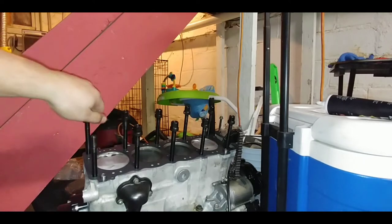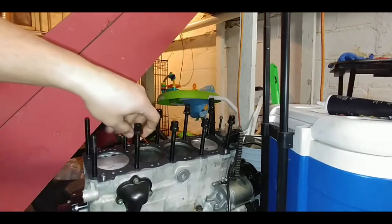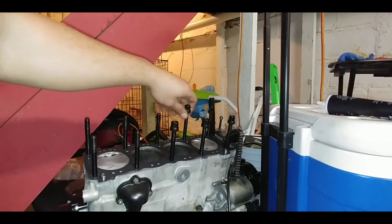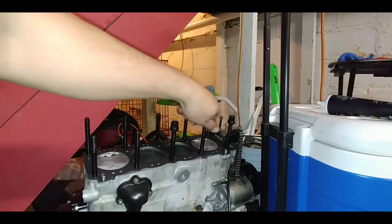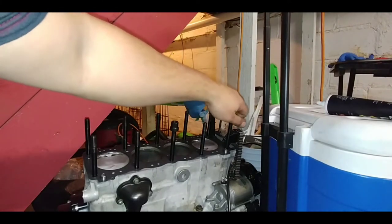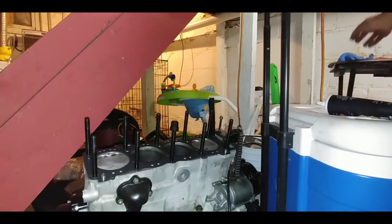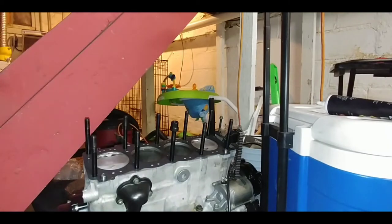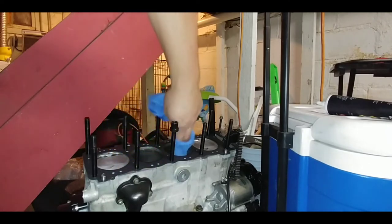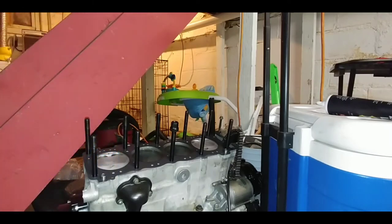Since we're here and we're ready, we're going to pull all of these nuts off — I just had them sitting there so I knew where they were. We dropped one in the cylinder. I'm going to wipe the cylinder out and wipe the piston off one last time — I've already done it once but I'll do it one more time. I've already done the other one. I'm going to turn the cylinder head upside down and wipe it off, making sure there's no oil, metal, or anything on the cylinder head surface. I've already done carb cleaner twice through the cylinder head.